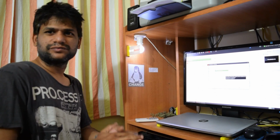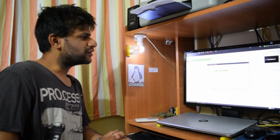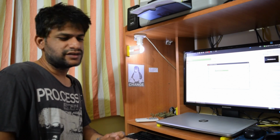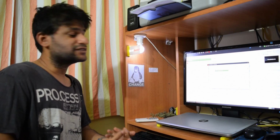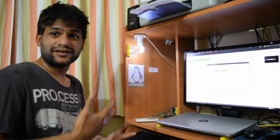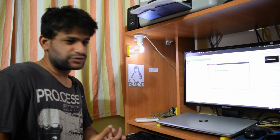So this is not a setup ideally suited for any production setup. You can imagine this is done on a real physical system. Just imagine for a while. What I have done is I have created a RAID level 10 pool, a ZFS pool. With this we can test its reliability, and also we can test what happens if you pull a couple of drives. And I went a little bit further, and I have also tested how it adjusts each time you upgrade your disk. It worked beautifully well.